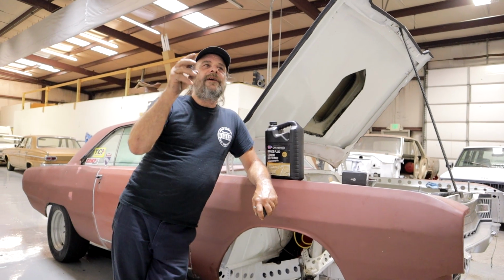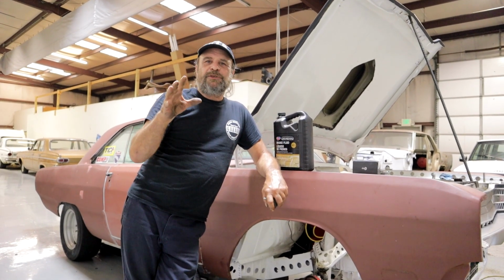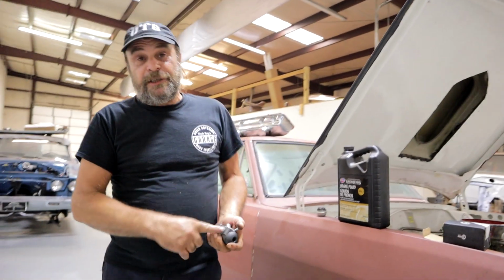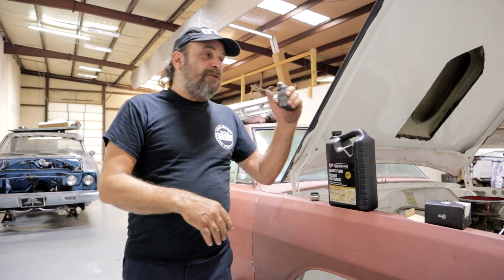And it's especially vulnerable to, let's say, '60s, '70s cars, underpowered daily drivers, and what'll happen is you'll develop a mysterious overheating problem, and you'll go crazy. You'll change the thermostat, you flush the radiator, you go through all of the different stuff. You add a shroud, you add extra fans, but no matter what you do, it'll still overheat.